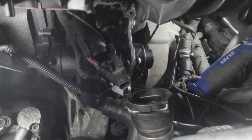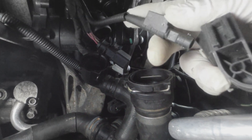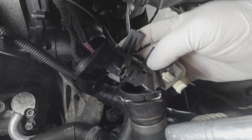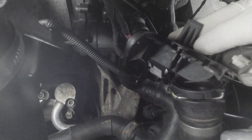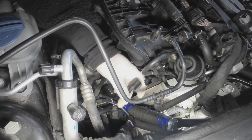I should have been finished by now but I have to take it all back apart again because of this one little wire here. This little wire was underneath and it was on here. What you need to do is make sure you take this out from this bracket here because it only feeds through that little gap there - it's a knock sensor. Just be wary of that guys when putting everything back together.